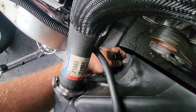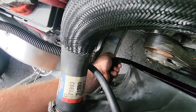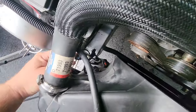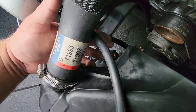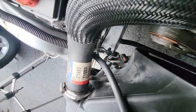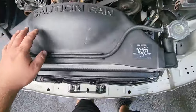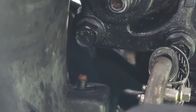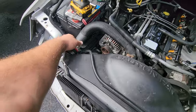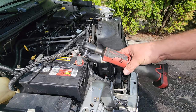Nothing like clean factory hardware with anti-seize on it. We gotta disconnect the fan motor right here — got a locking clip. These things are kind of hard to do, even harder with one hand, but I've gotten used to it. Now to separate the fan shroud from the radiator there are four 10 millimeter nuts or bolts — one way down there, one, two right there, and then the same on the other side. They're hard to get to and hard to see because of all the stuff in the way, which is why we had to make all this room.